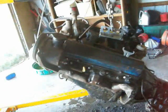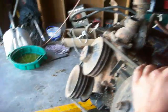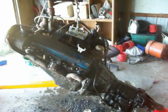I don't know when I'm going to get around to finding a parts washer, but hopefully fairly soon. I'll let this diesel soak and then it should be all clean and ready to come apart to replace the gaskets and whatever else I find. That coil's got to go, the freeze plug's got to go, take the transmission off, fix that leak, clean it up, and then start painting stuff. Still a ways out, but it's coming.